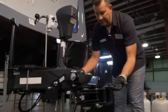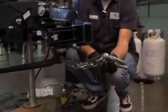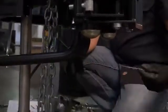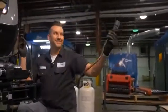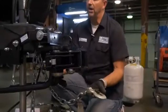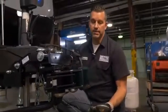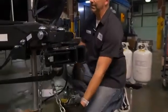We've also got to check and make sure once we couple back that we've got enough chain, because I can tell right now we're definitely going to have to extend it — that's fairly typical. His brake wire looks like it's wound up here, so once we cut this wire tie we'll have plenty of room, so he won't need the extension kit other than the chain piece. We usually recommend getting the extension kit because you may need the chains, the breakaway wire extension, and the seven-pin harness extension. Once we get this extended and everything tightened down, we'll get recoupled and get on the road.